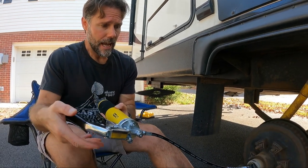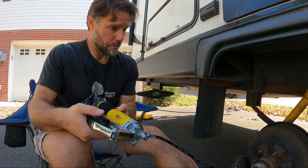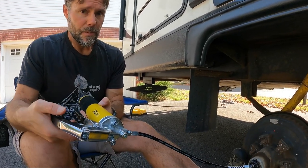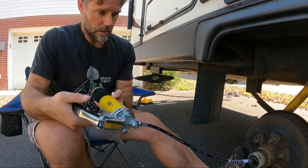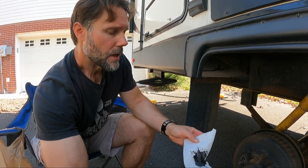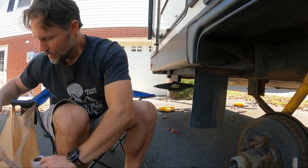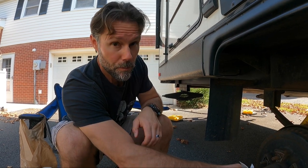We did 20,000 miles on this and I don't know when it had been done last — could have been 30,000 or 40,000 miles ago, because the last owners did a cross-country trip in this. The grease coming out does not have metal bits in it — it just appears to be used and dirty grease. The smoothness of the wheel is significantly better. I welcome comments — just be kind. Some of our awesome family followers have sent me comments about things I could look for in the truck or ways to improve maintenance, and it's so appreciated.